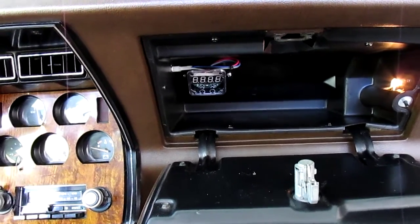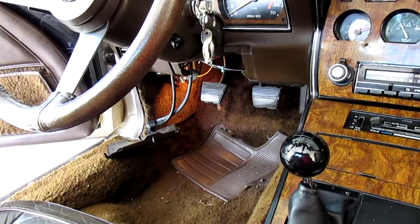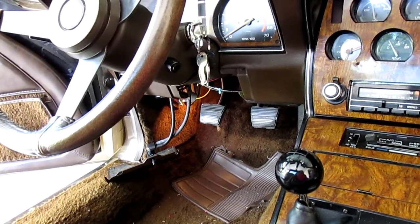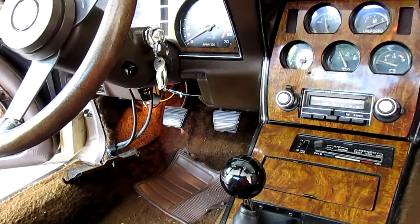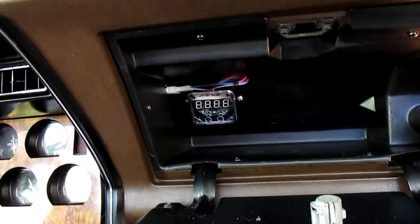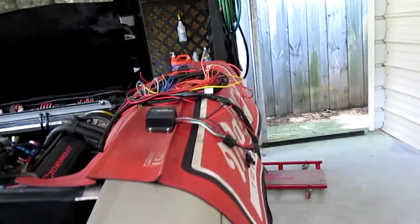I've already checked everything out and it works. I did have to go underneath the dashboard - I ran my wires from the glove box where the RPM switch is, over and tied my power into the fuse box, and also the ignition tach signal. I just went up under the dash and tied into my tach wire that came from my distributor. There's also a four-pin Molex connector so I can just unplug that and pull my glove box out if I need to.